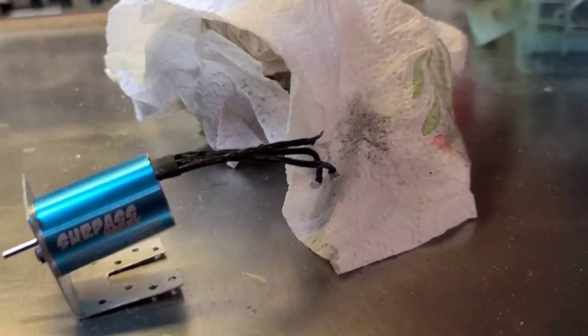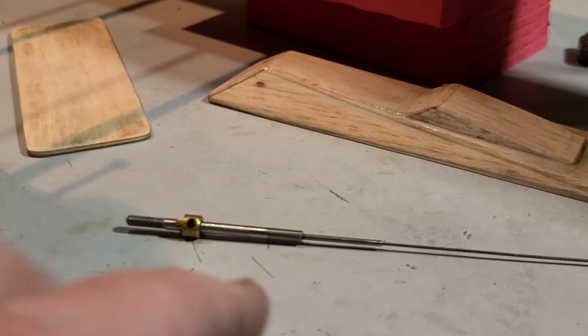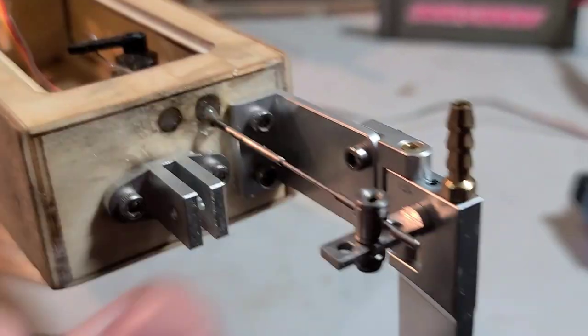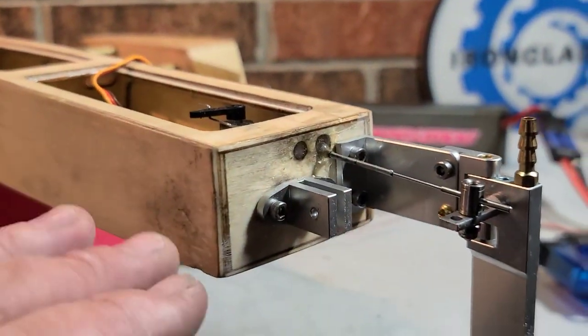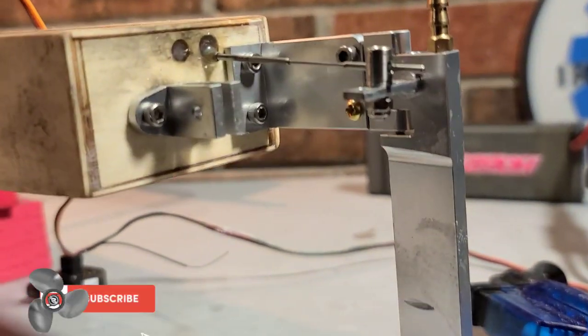I got the motor mount made and my rudder made for the boat. I had to do a different style bracket so it sits on the transom vertically instead of horizontally. I'll show you guys how to do the wire drive in an upcoming video. This is Dr. Jet's steering setup for the 120 - I stole his idea, I love this setup. I recommend this setup for 12 inch to about 24 inch boats - 24 inch would be pushing it. The second part of the build series with the shrimp outrigger we're going to do electronics and work on some odds and ends. See you next time. Thanks for watching - Big B with Ironclad RC, Shannon Wilbert, tinker, test, and build RC boats.